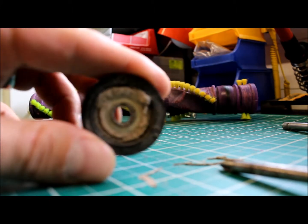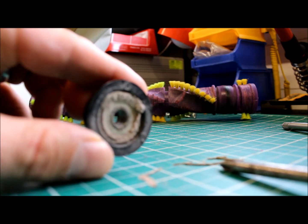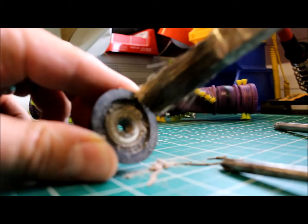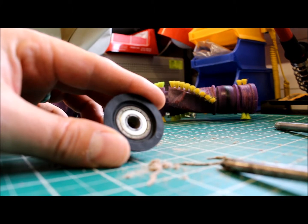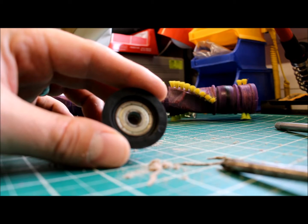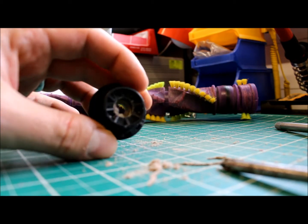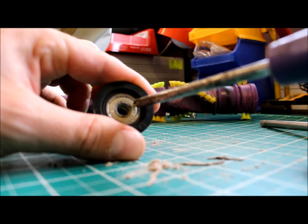As you can see, this bearing has got a load of dust around it — that's what happens with vacuum cleaners. That has to be removed with a brush and the bearing here in the middle removed from the outer casing. A little dust-down with a brush exposes a pretty generic roller bearing, which I'm hoping can be pressed out of this casing using a little drift. Then you'll see there's actually a metal cover on the bearing that I want to pop off.